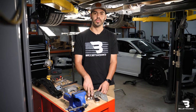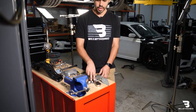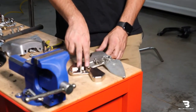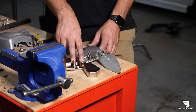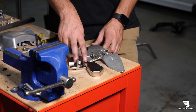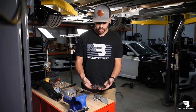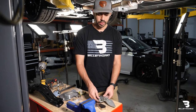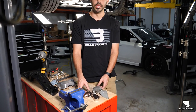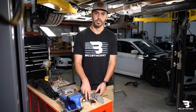To quickly go over the two main differences between our shifter plate and the factory shifter plate: as you can see, the distance between the two pivot points is a lot shorter than the factory — this will significantly change the throw of the shifts. You can also see that our shifter plate is heavier than the factory, which will allow throws to be a little bit easier, especially after we're shortening them. So let's keep moving.